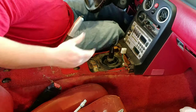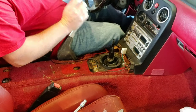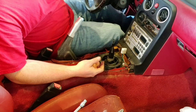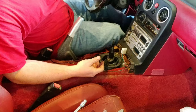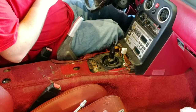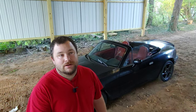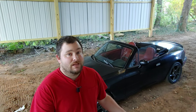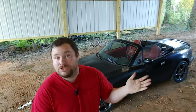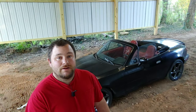That's great! And that was only like — I think I paid $13 for that little plastic bushing. So look at that: 10 minutes of your time, about $15 with tax, and you've got a good shifter again. I can't wait to drive this thing now. The shifter's fixed — might have to put a new piece in another day to make it a little tighter, but right now that's pretty good. All you need is a 10mm socket and a screwdriver, and 10-15 minutes of your time.